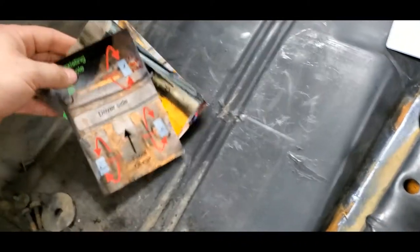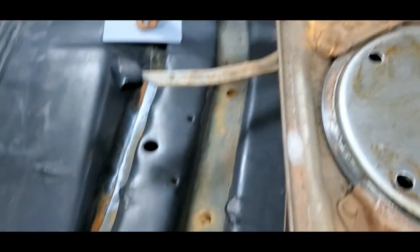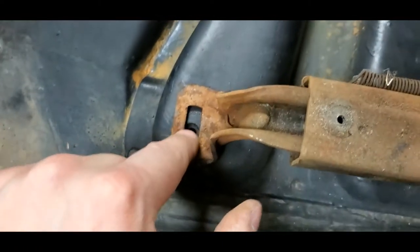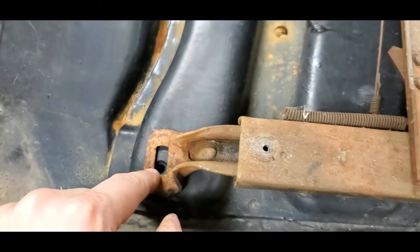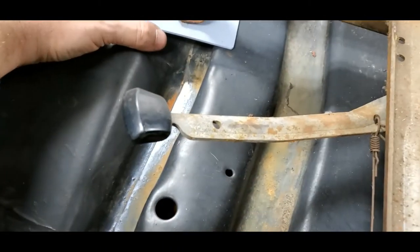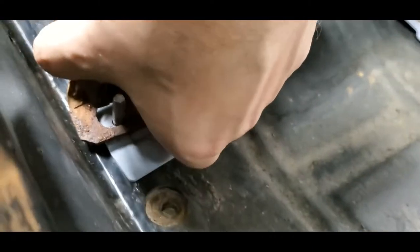When you get this kit you'll get some pictures showing how to do this. You are going to need a MIG welder to get this done — there's no way around that. Basically you use your existing hole for your front mounting point where your bench seat would have mounted. Set everything up, get them all lined up in the middle of the holes, get them all set up so they're ready to go, and then mark your spots.